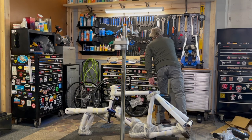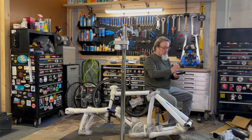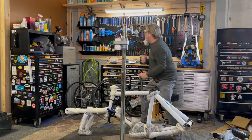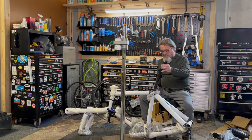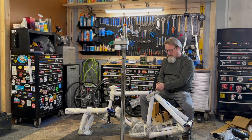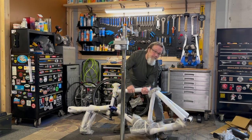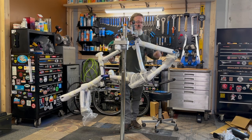Use that stock seat post. You know, lube that thing up a little bit, just because we need to have some lube in the frame anyway. It's my putting on some grease sound. All right, looks like we got a 5 millimeter. With these cargo bikes, it's always interesting to use a standard bike stand. And maybe we'll get a motorcycle table or something. Like with the bullets, we typically just leave the front wheel on the ground and lift the rear up to access the drivetrain. It's real nice. No front wheel yet. Can't do that. Left. All right, bike in stand.